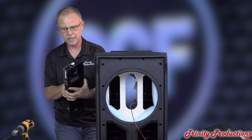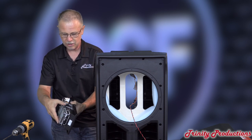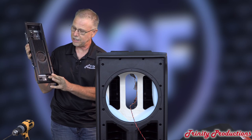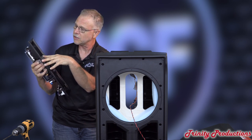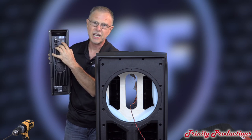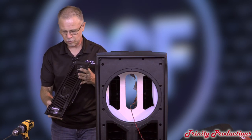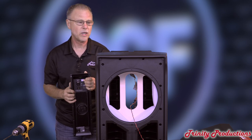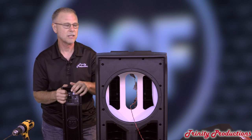As far as the amplifier is concerned, it looks like the standard amplifier that's in the Evox — power transistors and semiconductors along the side going into the heat sink, 115-volt operation, power switch, fused IEC input. You've got XLR in and a link through. You've got a volume control and input sensitivity. Noting that you've got input from the mixer coming in here, limiter signal and power lights, and it's got a flat and a boost mode on it — just like the RCF Evox series.